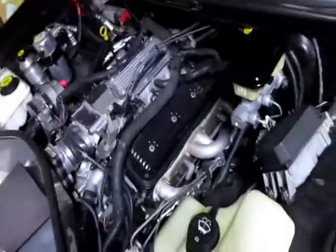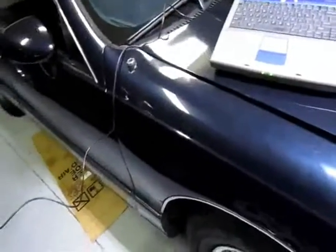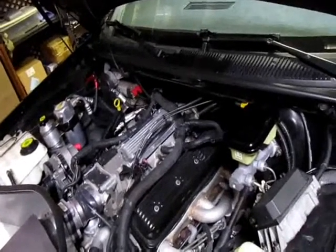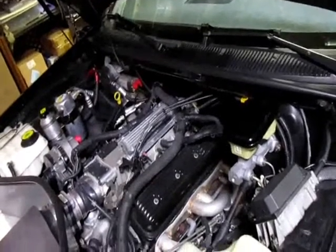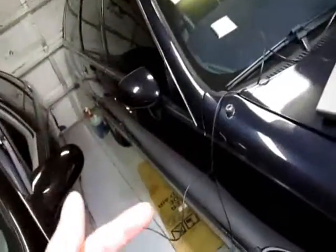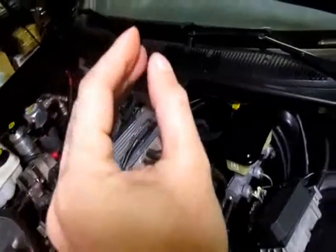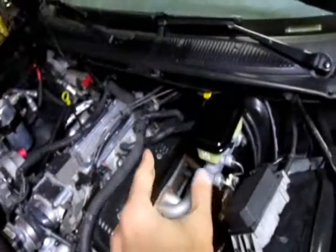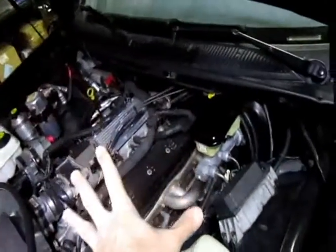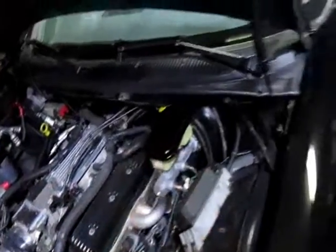The other thing: this vehicle is a 95. Not like the truck. But in 95, the geniuses decided to put pulse width modulation on the torque converter clutch. So instead of on-off like my truck has — where it goes boom, boom, boom, which I like — this car just slowly engages it and allows the torque converter to slip.